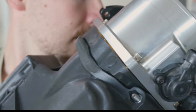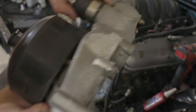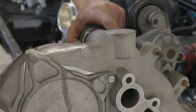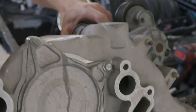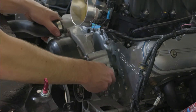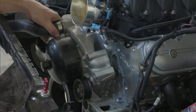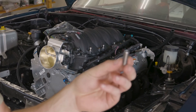After Dremeling the plastic, test fit it again — still didn't work. So you also need to use a flapper wheel, grinding disc, or whatever works, and shave down your water pump. I'll cut to a few shots of what it looks like after it's done. You can take off quite a lot of material and get away with it. Alternatively, you can get a different LS water pump — I believe an LS2 water pump clears everything from the factory. But if you've got this one, shaving it down works; worst case you ruin it and get the right one anyway.